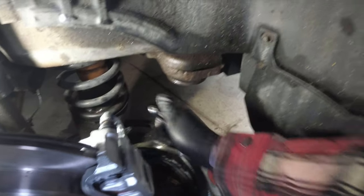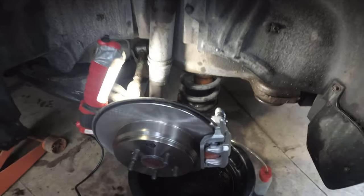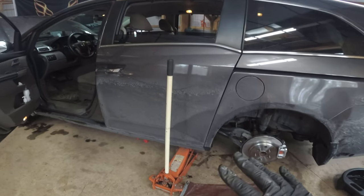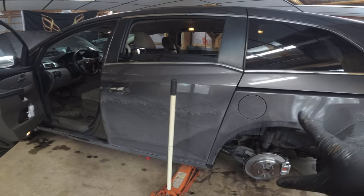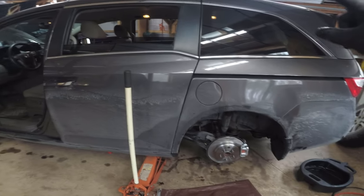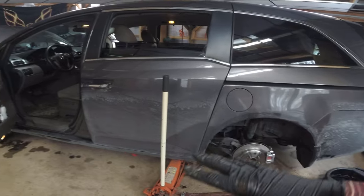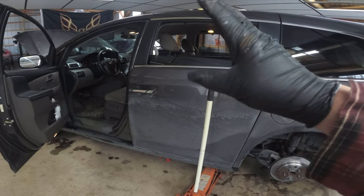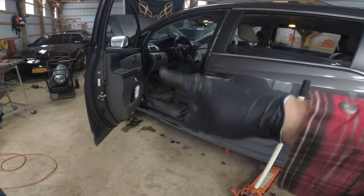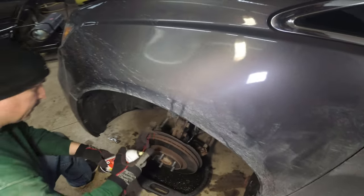Give it one final torque and replace your rubber cap, then reassemble the wheel. When bleeding the entire brake system, start at the brake caliper furthest away from the ABS system — usually under the driver's seat. We already did the passenger rear side and just finished the driver rear side. Next we'll do the passenger front side — just pads and rotors — bleed that side, then finish with the driver front side which is closest to the system.